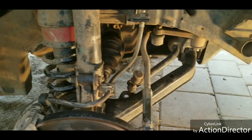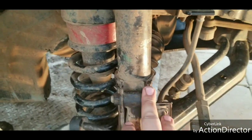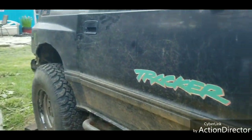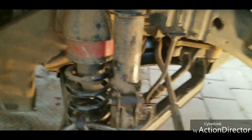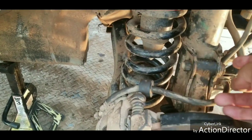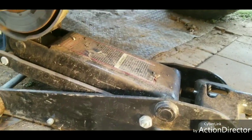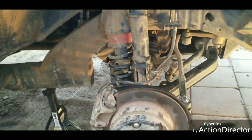Third thing that you guys may have noticed is that when I went ahead and cranked these nice and tight back again, I'm not terribly worried about alignment. Obviously it's mostly off-road, so not terribly concerned, doesn't get a lot of mileage. Secondly, when you put in the spacer lift, you can either buy camber bolts to adjust the camber here, or you can actually hog out, which is what I did, is hog out that section to make that hole oblonged and push everything back. That's why I moved the jack to underneath the farthest section here of the spindle to try to get it to push up in there a little farther.